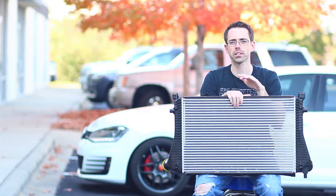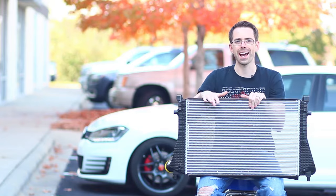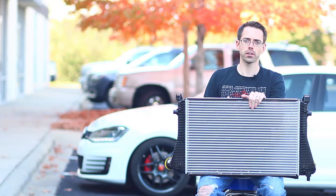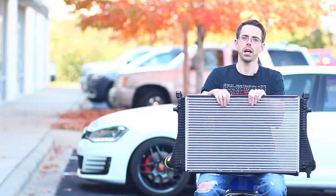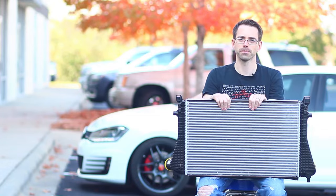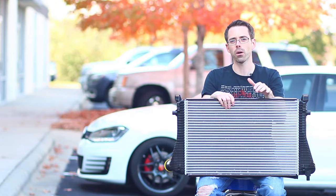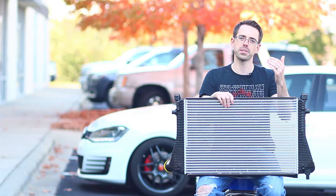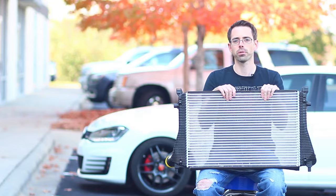The most common reason to put an upgraded intercooler on your vehicle is heat soak. Basically, as a vehicle is running — taking pulls on a track or just driving around town — the ambient air temperature of the engine creates what's called heat soak. That means you have a lot of hot air in the intercooler and all around it, and the intercooler cannot keep up with the amount of heat in the engine. Upgrading to a larger intercooler doesn't necessarily gain you power — what it does is prevent you from losing power in the event of a heat soak issue. A more efficient, thicker intercooler core will bring temps down further if heat soak occurs and temps continue to rise, whereas the stock intercooler can only do so much.